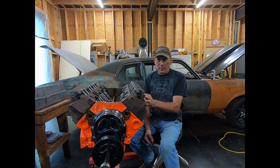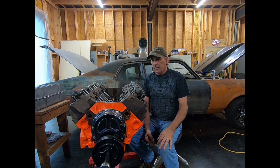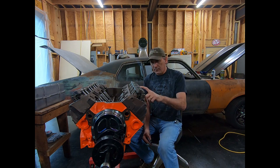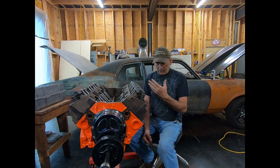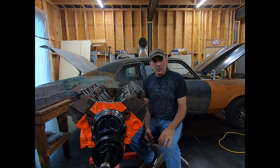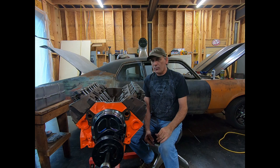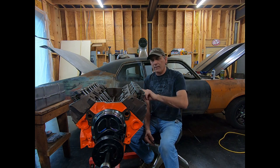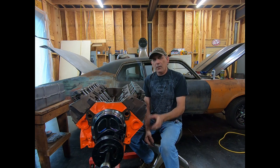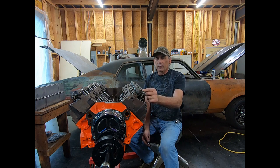I've got a whole video I'm working on about the build of this .307 — you guys are going to like that. Anyway, since I've got regular studs and not screw-in studs, I couldn't use a full roller rocker. I didn't think about that until I went to put the full roller rockers on and some of them hit. So I ordered these Comp roller tip rockers. They still have a ball pivot and a regular lock nut — more simplistic than a poly lock. The drawback is a little more friction at the ball pivot, but they last hundreds of thousands of miles on stock cars. These are Comp Cams 1.52 roller tip rockers. If you're going to put rockers on your car and you have stock heads without screw-in studs, this is a good set to use. I'll put a link in the description to these rocker arms — they're a little pricey, but they're Comp, they're 1.52, and they're a high-quality piece, much sturdier than your stock stamp rocker.